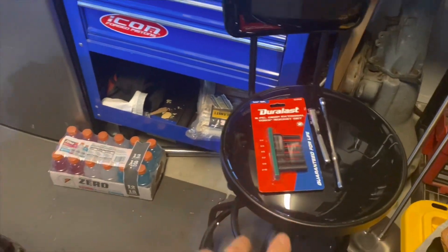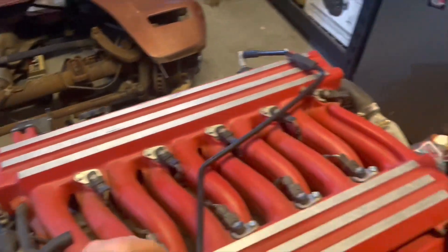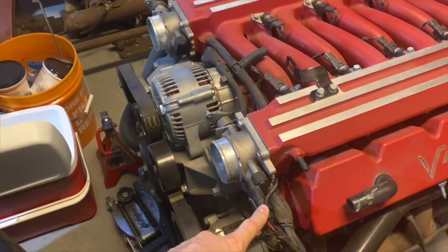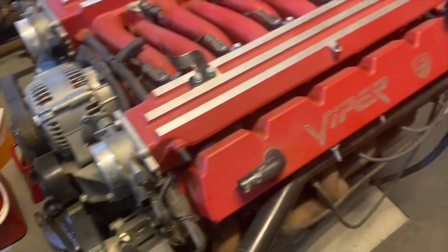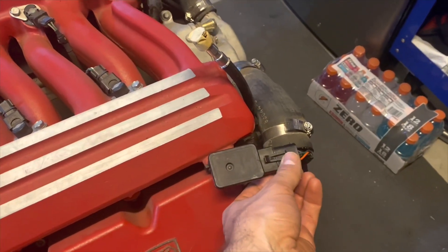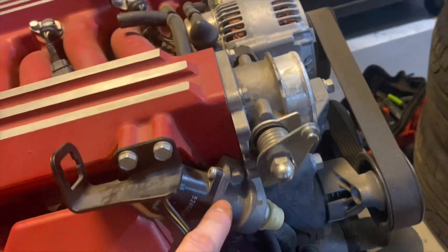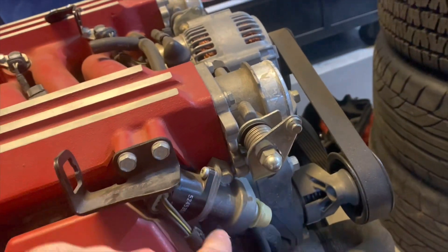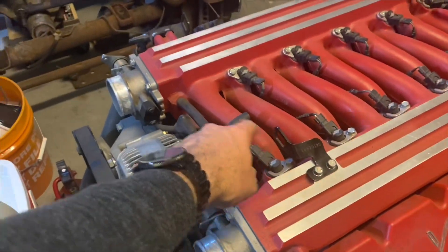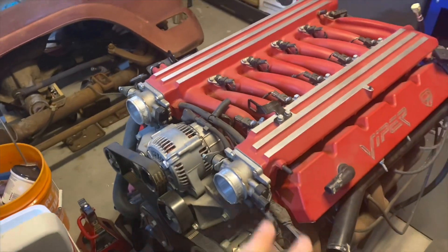Before you even open up this package, there are a few other things you've got to do to the intake manifold in preparation for its actual removal. Obviously, you've got to take off some things like the PCV, which is super easy. But all the little sensors, like your throttle position sensor — it's just a clip, pop it up, pulls it out. This is the manifold air pressure sensor. This one actually broke on the plastic piece, so be careful with that. You also have to pull out the air idle control valve. You can either unbolt it, or just pull the sensor cable. And if this is in your car right now, you're going to have to disconnect your throttle cables or the mechanism if you've got a Gen 2 that connects them both together. Just make sure it's not still connected to the car.